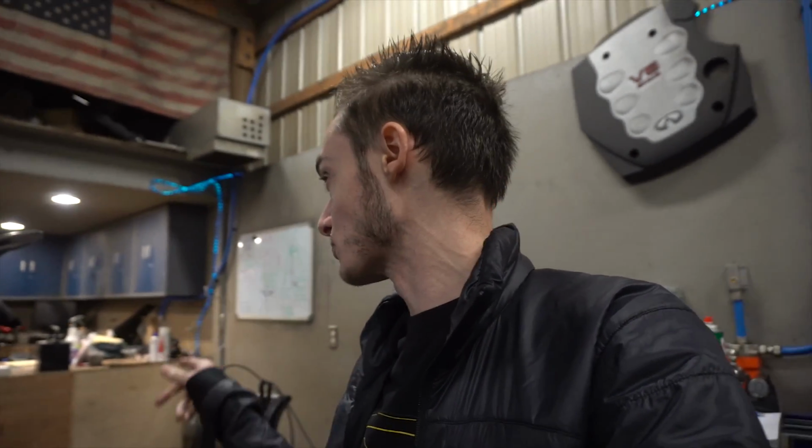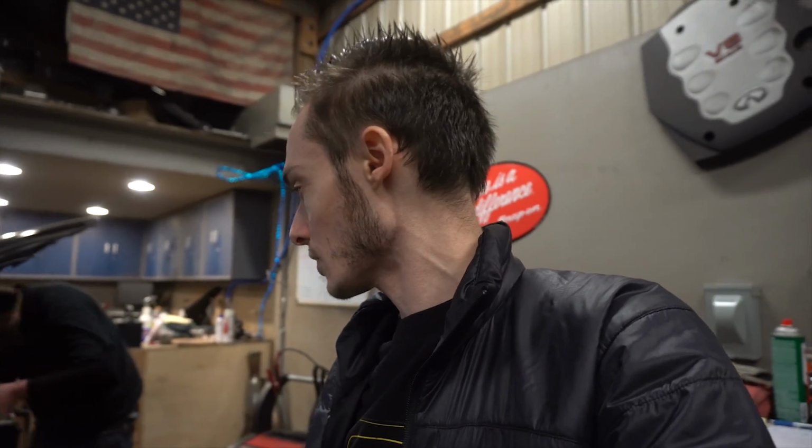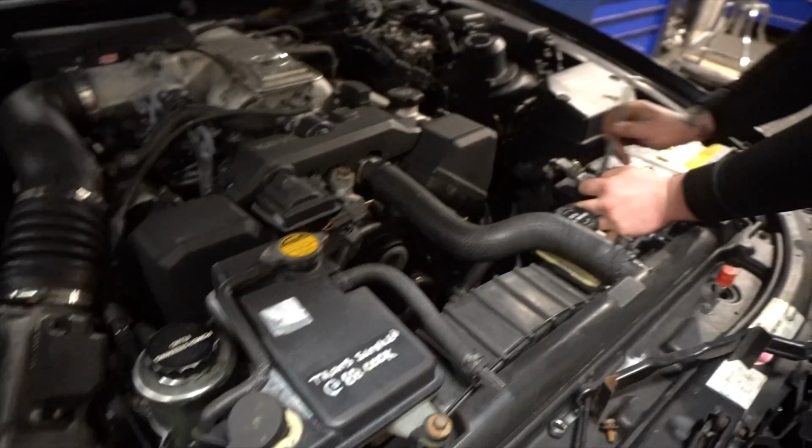to fix the batteries. We got to pull the old ones out of it. I got some fresh ones here. We're going to put some lugs on them so they bolt on the top of the battery with a 3/8 stud and a 1/2-inch nut. Much better in my opinion for a diesel truck. So we're going to get the SOAR fired up. We got the Ram running, and then get this moved out of here, move it in, and get that stuff done.